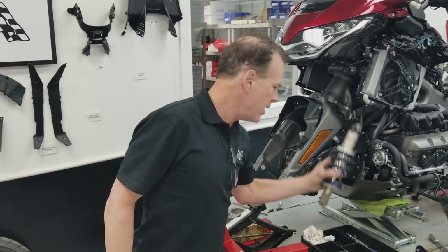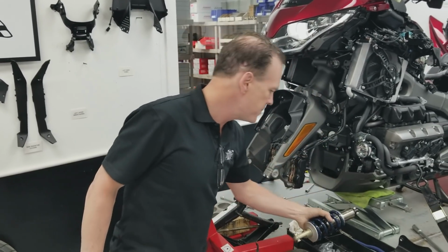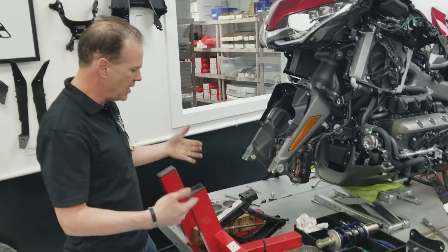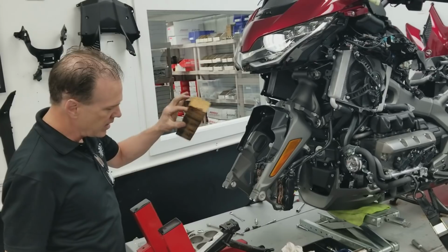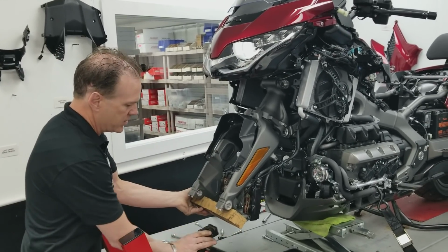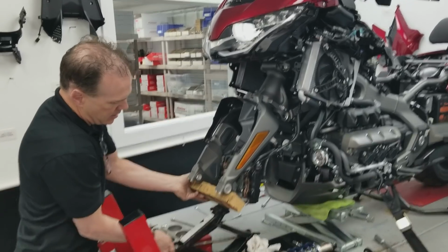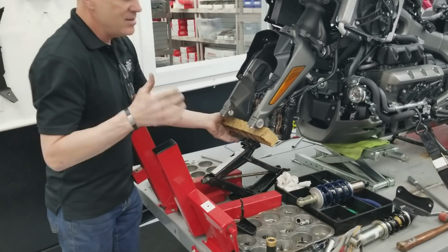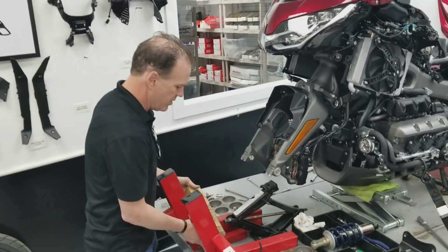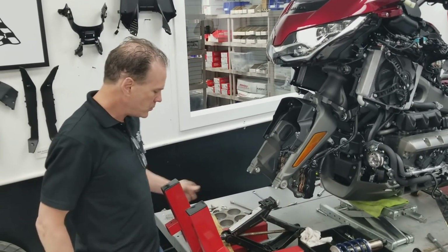You'll hang the new shock in there, and once it's in, again, I like to take the slack out of the bolts. I've been using just a little block of wood under this groove in the fork and a scissor jack. We'll raise up on the scissor jack, take all the slack out of all the hardware, and then torque everything the way we want it tightened up.